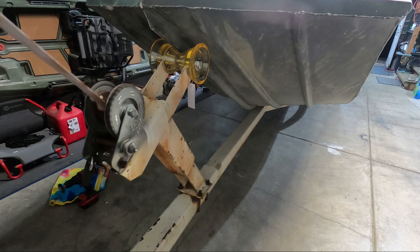Now the winch has been replaced. The last thing I want to add to this trailer is a new transom saver — in my previous video I removed it to better work on replacing the bunks. I've got a new transom saver and I really like the mount that came with the trailer. I'm going to use these same mounting holes but drill straight through the trailer, with new hardware bolted through to secure it. With the base installed, the last part is putting on the transom saver — it just slides right in place. Put your pin in and it clips on like that. Once we actually get the motor mounted up, we can adjust this for length.